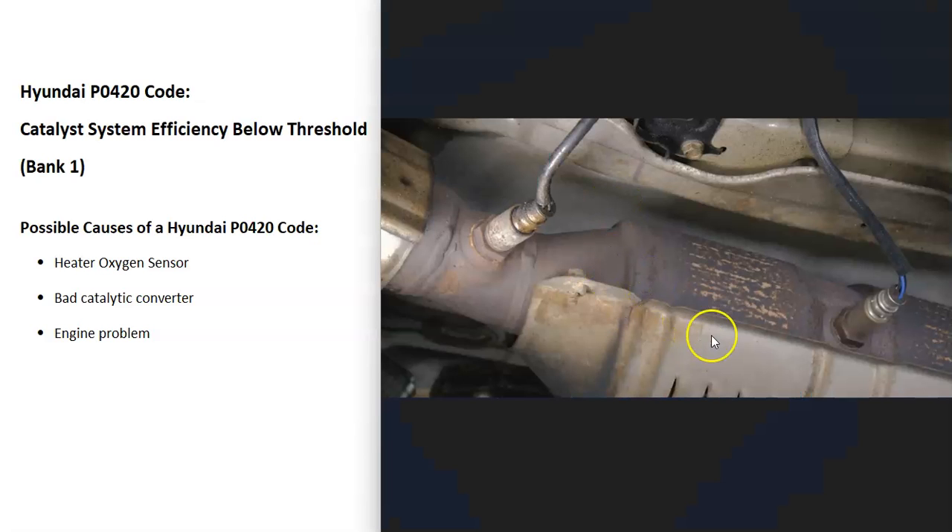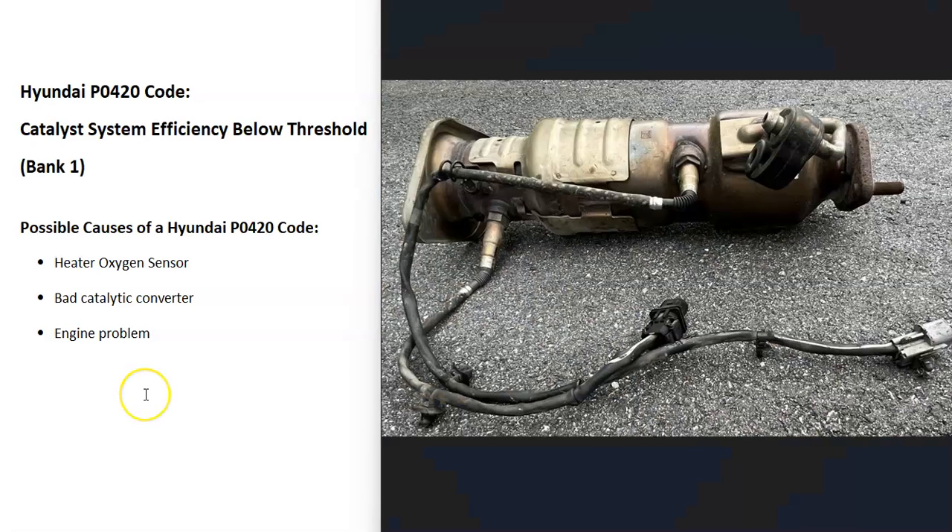What does this mean? There are sensors located on the exhaust and they do two things. The first thing they do is monitor how much oxygen was burnt off during combustion, and then the vehicle's computer uses this information to adjust the air fuel ratio mixture going into the engine. The second thing they do is they have heater elements built in that monitor the catalytic converter. When they see that the catalytic converter is falling below 97% efficiency, they report this and the computer sends out a P0420 code.